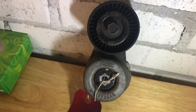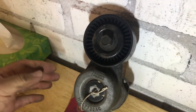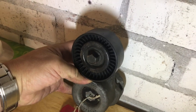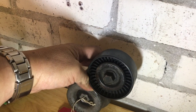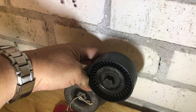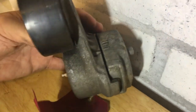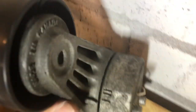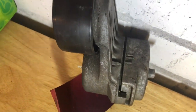Here's one I prepared earlier — this is an old and actually damaged tensioner, sitting in the same orientation as it is on the engine. The basic action is: there's a spring in the bottom pulling it over, stretching your belt. As the belt gets tired it goes further and further over trying to tension it. Let me show you the bit I was struggling to show you on camera — it is visible with the naked eye, it's just very difficult with the light and camera together.